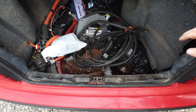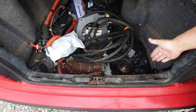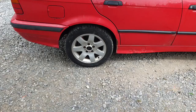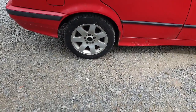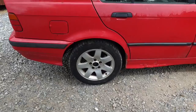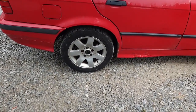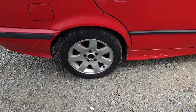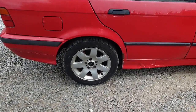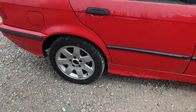What in the Sam Hill — under all of this cable and various other things in here — do we have two new differentials? One of the problems I think caused that half shaft to pop out of the differential was that the toe plates were all set fully in — I hadn't bothered doing anything on that. So that wasn't good. As you can hopefully see there, the wheel is a lot more centered in the wheel arch with those adjusted reasonably.